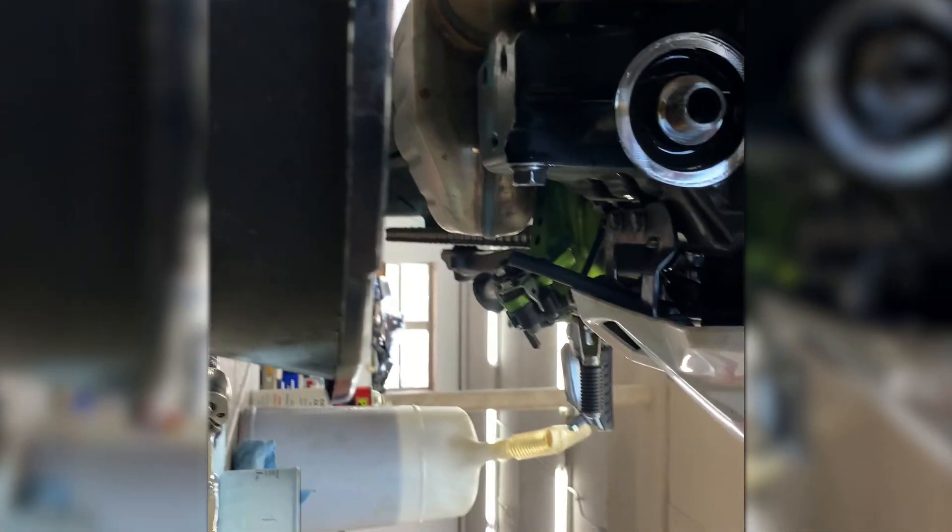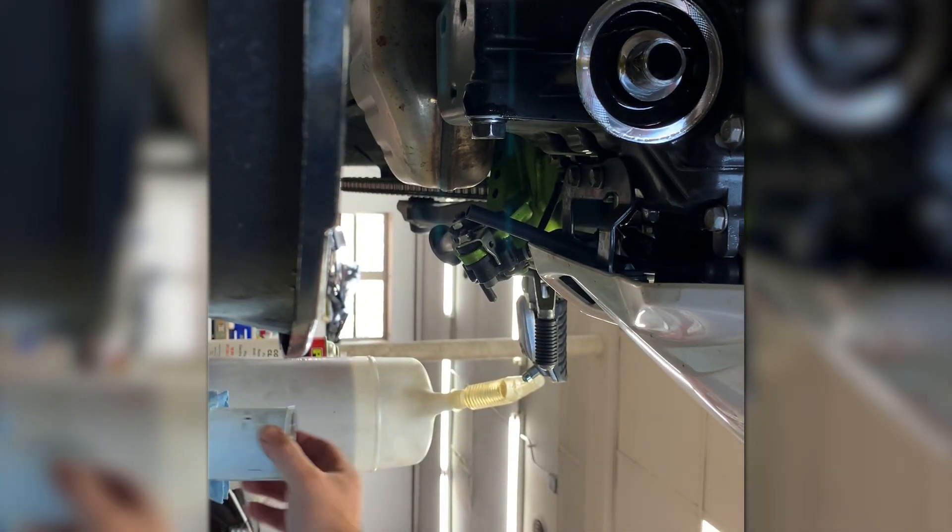It's a little bit of added insurance that you're not going to over-tighten or strip the drain bolt. You have a fresh aluminum washer, so put it in tight like that. Then we'll go ahead and replace our filter.